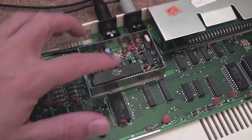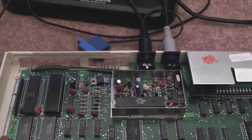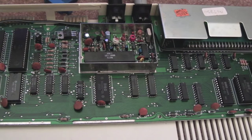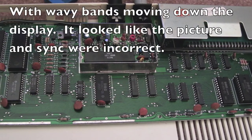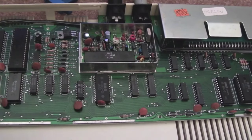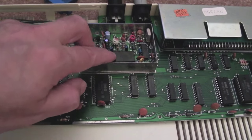It's confirmed my suspicions there's a problem with the VIC chip on this. I'll show you — it's got the original VIC in there. Point to the screen, switch it on, you need to get a click and there's no sync — you still get the blue screen from the TV. It's not presenting a display signal. I did connect this up to a TV with composite input, an old analog TV, and what you saw was like a black bar with a white screen — about a third of the screen on the left was a white block, and the right two-thirds were black. So it's a bit strange, and that click is the sound, and that's not normal.